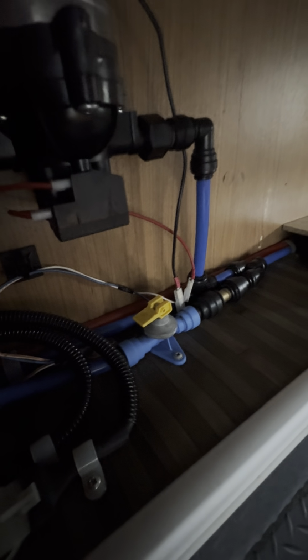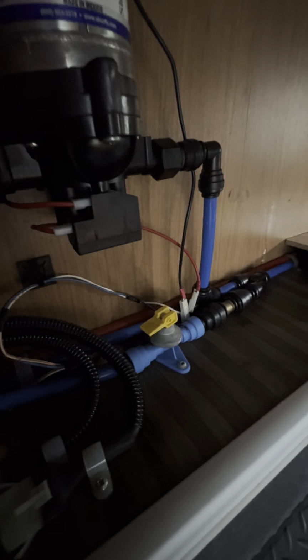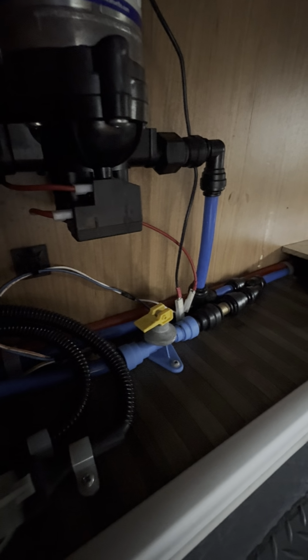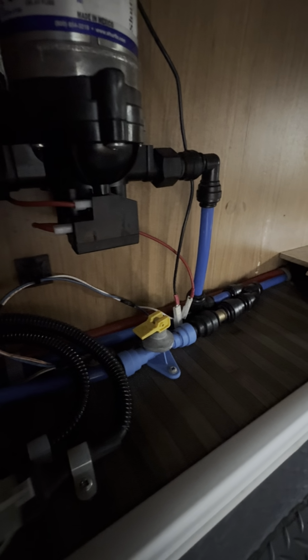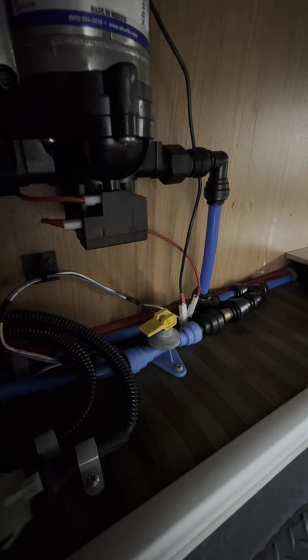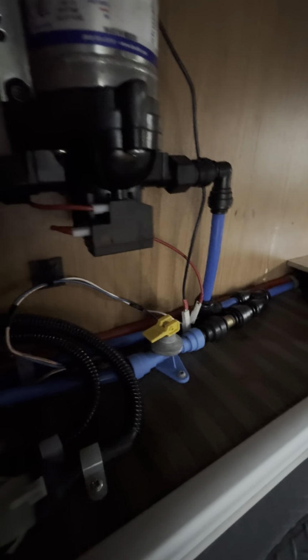Still on the point of the boiler, first of all, this is your water pump, just whilst we're here. But the boiler itself has got this little yellow handle here, this is your boiler drain-off valve. So if you wanted to drain the boiler out of all of its water, which is about 10 litres, you would literally lift that little handle up and it would start draining out all the water from the boiler. Now, the only reason you would do that is